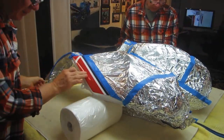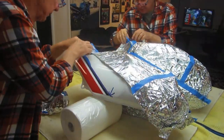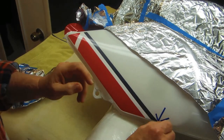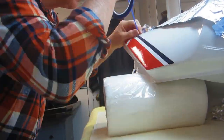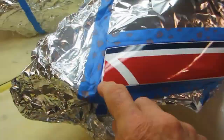This is the way I have done this in the past, both on model airplanes and on motorcycles. Pull enough of the back mask away to expose that tape — it's the tape that's going to be the edge of the clear. I want to get that off and then move that back up about a 64th of an inch. What I'm trying to avoid is self-explanatory: I don't want a giant edge, I want to minimize the edge, so that when I'm done and I've buffed it out, you almost can't feel that edge. That is the secret to not having to paint the whole tank.